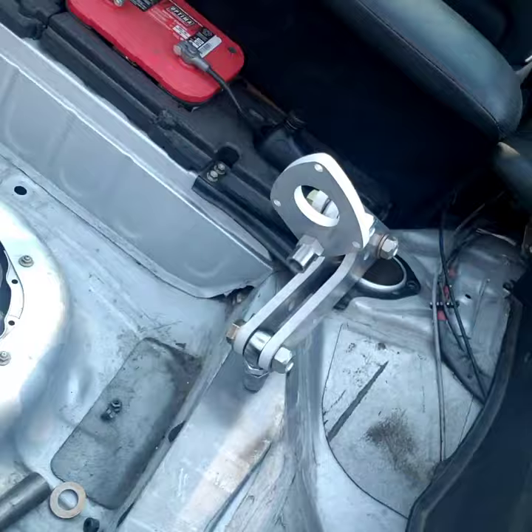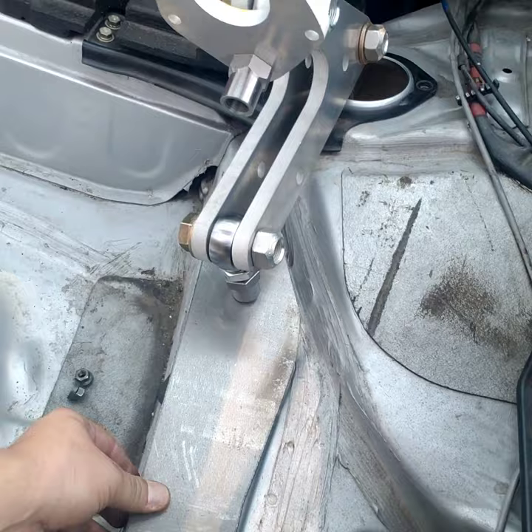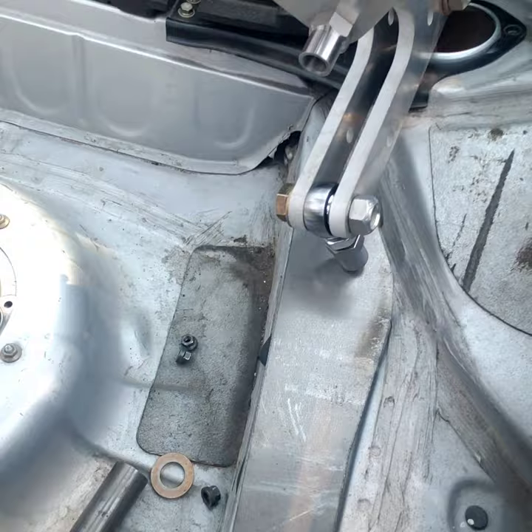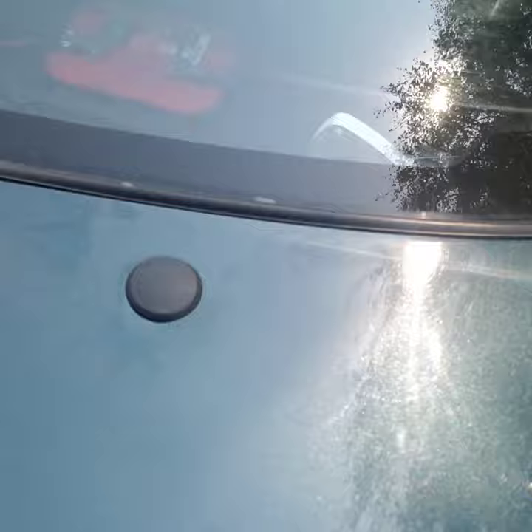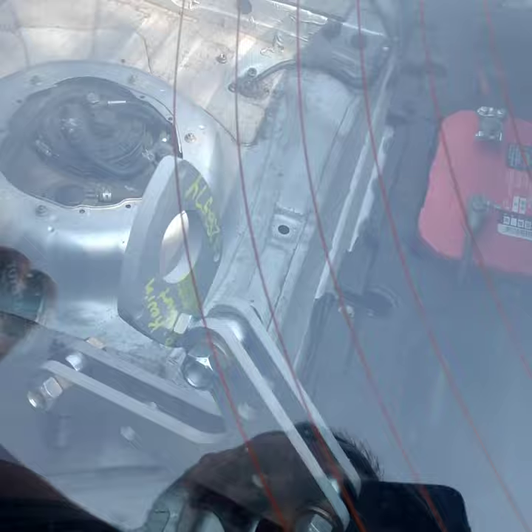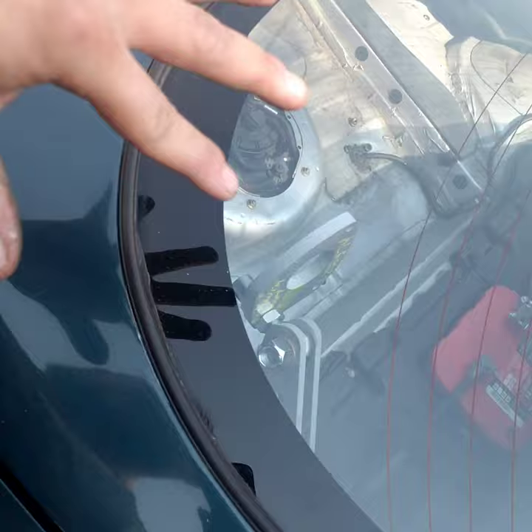I took one side off and I'll show you how it looks. I've got my base plates in — they're going to get welded in, and whatever piece I need for this will get welded too. This isn't sitting 100% centered right now, but here's the general idea of how the push rod suspension is going to work. I still have to adjust this side, but there's plenty of room. Once it's welded in and nice and firm, it'll be more straight.